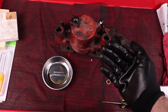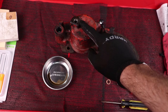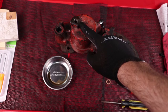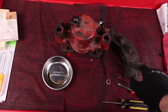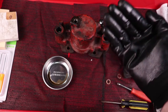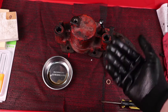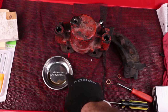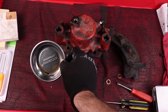To force the piston outside of the caliper body I'm going to be using compressed air, applying it through the hydraulic port on the back of the caliper where the brake hose was connected. Before I do that though, I want to share some advice: I've removed the pads and I'll get those completely off the bench so they don't get contaminated with brake fluid. Also go ahead and try to pour as much fluid out of the port as you can — any fluid left in that cylinder is going to go potentially everywhere once that piston finally comes out. I just poured mine into my magnetic tray, and all of that rust in the fluid is really not a good sign.